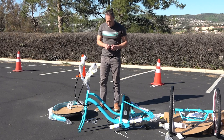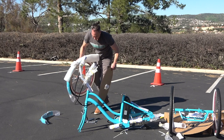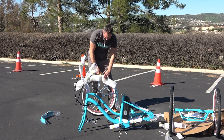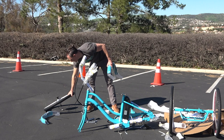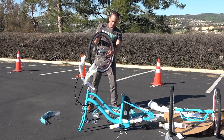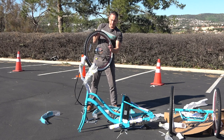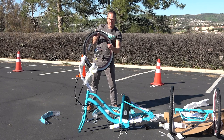We'll go ahead and put the rear reflector on the other rear fender. The other rear fender is attached to the front wheel — that's just how it works best for packaging, which I think is done quite ingeniously. I'll set the front wheel aside again. Be careful with this front wheel — the motor has a wire coming out of the axle, which is a delicate area. There's also a little rubber cap there to help protect where the wire curves. Also where the wire connects, it has tiny little pins that are very delicate and fragile — if you break one, the bike won't work. Be super careful.